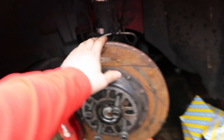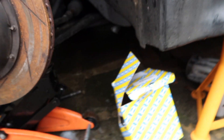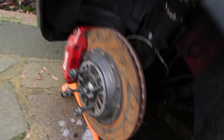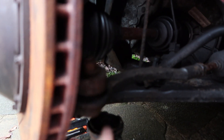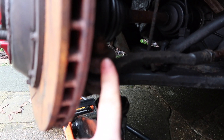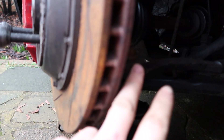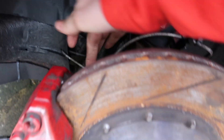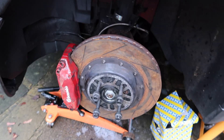Back in my little red jumper. I've just had a lecture. Rosie stopped filming because she had to get some bits done, and I needed to rush to get to a lecture. But I will just show you the progress that I've made. Currently, got the discs back on, all bolted up with the calipers. Lower wishbone, which is down here, is done. This is just supporting the control arm. We've got the suspension arm, and we've got the steering arm as well — or like the outer tie rod — which is finished here. All I've got to do is there's a bit that I've got a zip tie here round the back, and get the wheel on. As you can see, no play at all — nice and rock solid, which is exactly what we wanted.